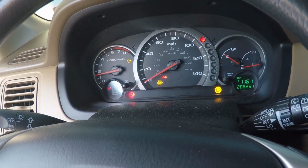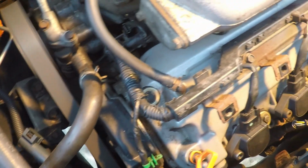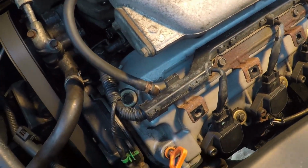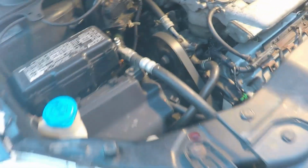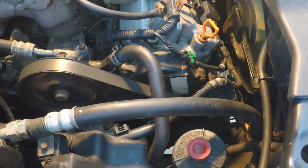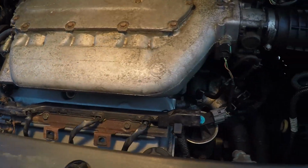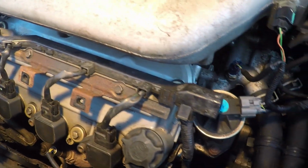And the vehicle fires up without any issue, and everything looks like it's put back together. Now, doing it yourself, I saved about 1 hour of labor from Honda, which is about $165 here. Obviously I had a lot of problems with this one, but ultimately it went back together without any issues. If your PCV valve were to be able to be removed from your engine without breaking off, this would be a very easy job. If you end up breaking your PCV valve off, it is more involving, but it's still quite doable.